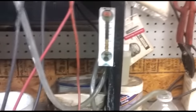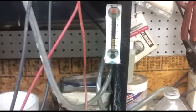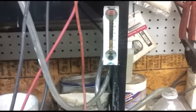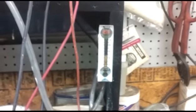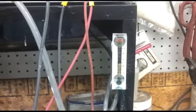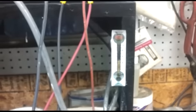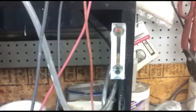Now roughly about an hour later of running, we're up there five to six liters, so it's moved up a liter. This one cell puts out five liters a minute, which is more than adequate. According to academia, you only need a quarter of a liter for every liter of engine size — so if that's the formula for HHO concentration, there's enough here.